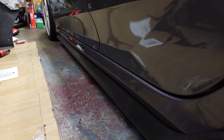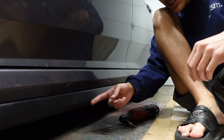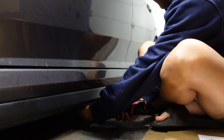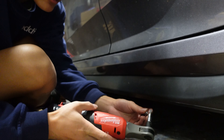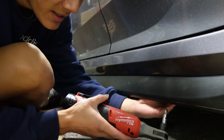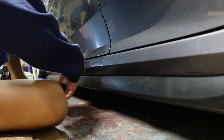I'm adding additional screws staggered — two more on each side toward the middle — for extra security because I really don't trust these clips. I can choose anywhere I want these two screws to go. First one toward the center of the car, the one toward the rear more toward the exterior — good for balancing. That makeshift screwdriver is pretty good. For the rears I'll go a little closer toward the outside. There we go — sealing up that fitment. Fitment on this is beautiful.